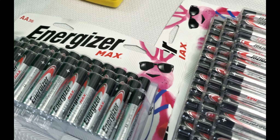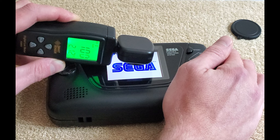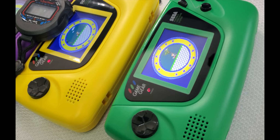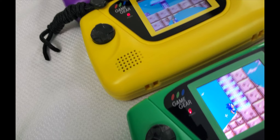For this round, we'll be using Energizer Max batteries from the same batch packaging. Battery batches have been known to be off depending on the age and region of manufacture. Let's dial all these devices in at 100 lux and see how they perform in this real-world example. One thing to note about these tests is that depending on the viewing angle, some Game Gears will appear brighter than others. This is one of the main drawbacks of a TFT display that IPS commonly solves — some devices will appear like they're turned off or full bright depending on the viewing angle. Hence why I opted for the lux meter.